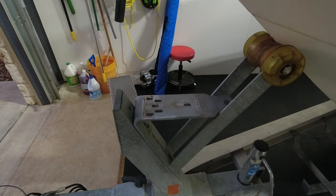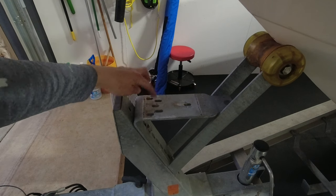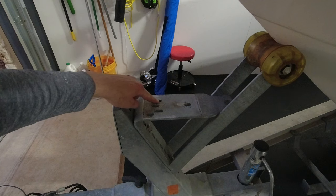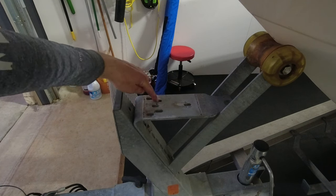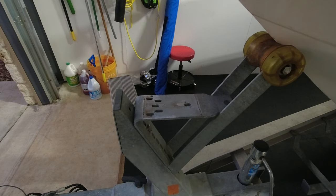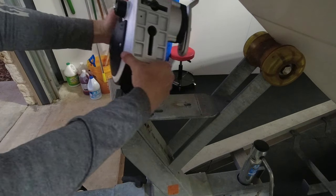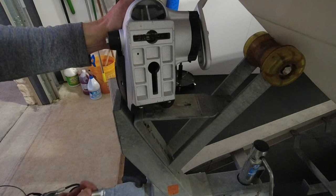Alright, now we're ready to bolt the winch up. Here on this Ranger trailer, if yours is looking like this, you're probably using the same bolts. The footprint it needs uses these two closer holes and this one. Now I'm going to take the winch, prop it up on the winch post with the view of the bottom side, exposing those grooved slots.